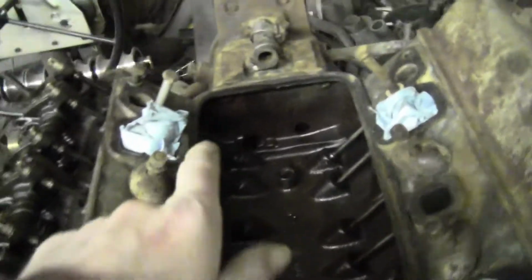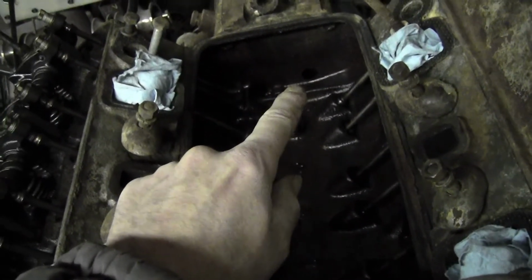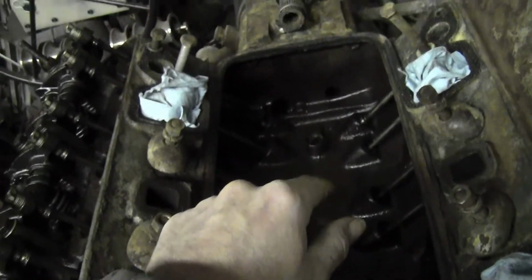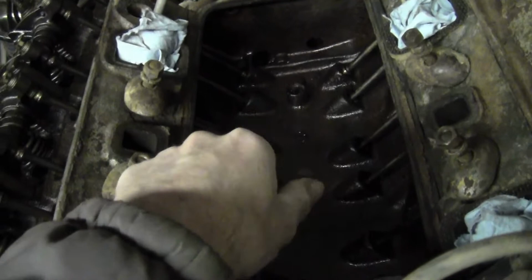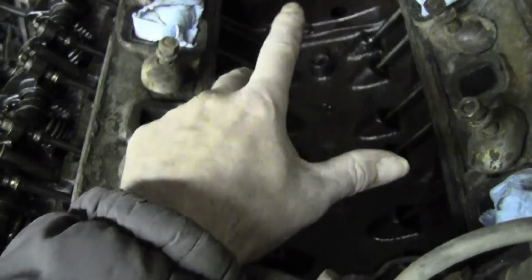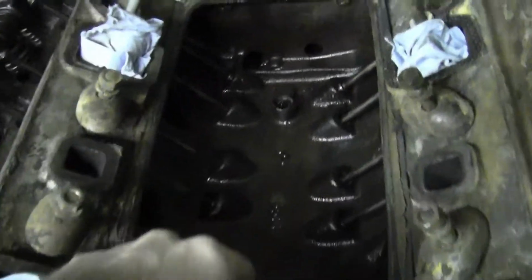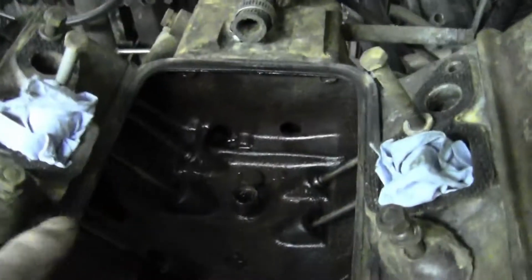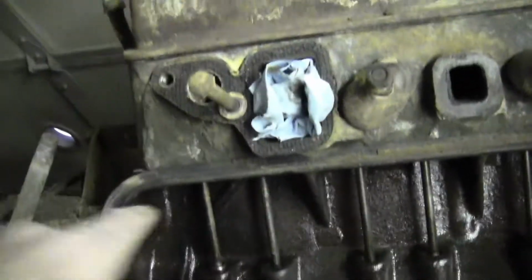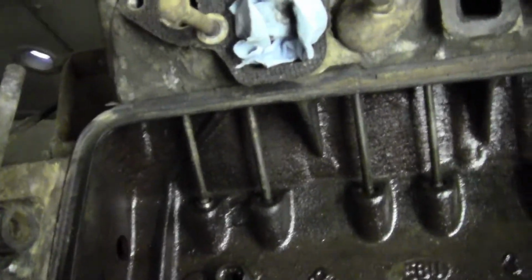And you can kind of tell the way that the oil has run in it by looking at the lines on it. This block had a, oh, what's that red paint? Machinist paint when they rebuild the motors. How well that really works. You can see how it makes a slick surface for the oil to run back on. So when you're rebuilding a motor, if you can still get this stuff and you want to take the time to clean it good enough to use it, that stuff really works. You can see that trough there, the oil trough, clean as day.